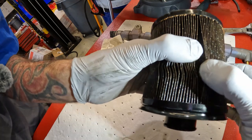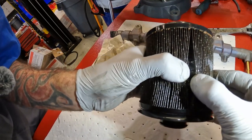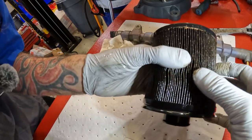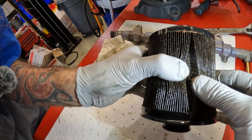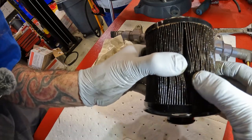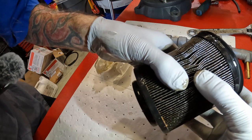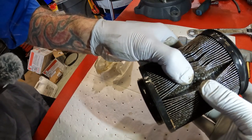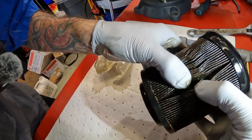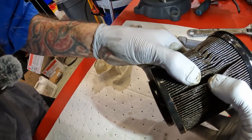I'm not going to go through every one of these but there's not supposed to be any kind of debris in here. Then I have the upper fuel filter — we're going to dump it into that jar right there. There was a piece of metal. Surprisingly, this thing was still running before we put the DCR in.